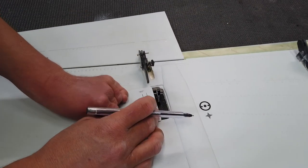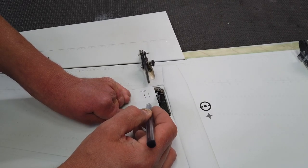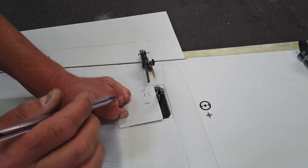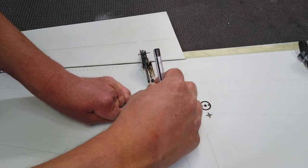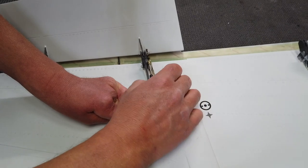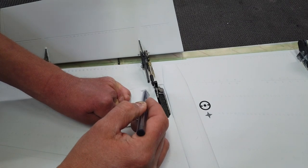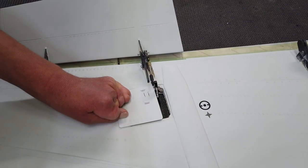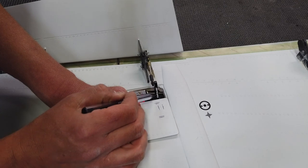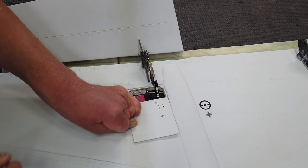We're going to basically get it lined up. I obviously did all these marks already, but we don't really know where it's going. So we make our backward mark — which is actually a little bit too far, so we can go to about there, which is fine. Then full servo deflection, we're going to be somewhere in that range. Then we just mark our forward location — that will be good. Then we move the cover over to the side and mark this edge, adding a millimeter or two. Now we've got our location.